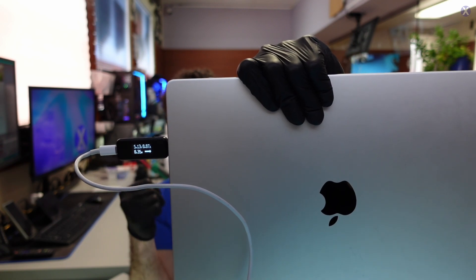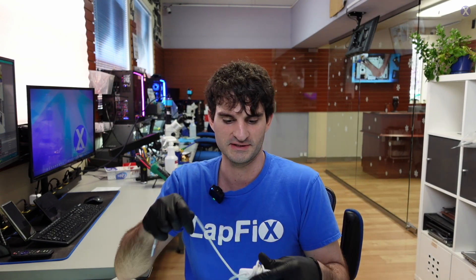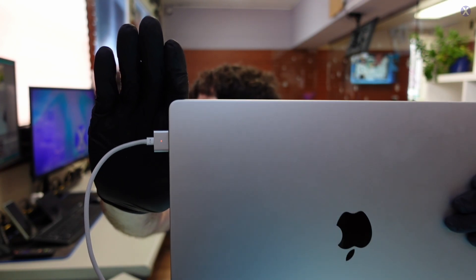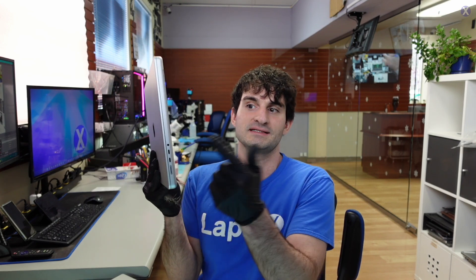For these M2 Max machines, you have to have all ports working for them to power on. You might be asking why use USB-C — why not just use the MagSafe 3.0 connector? Well, we can do that. And this isn't going to work either. As we put out in our other video about MagSafe: technically, if you look at a board view or schematic, MagSafe 3 is still considered USB-C charging. So all ports and their chips have to be working for it to power on. Let's open it up and take a look.